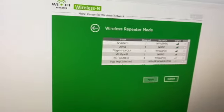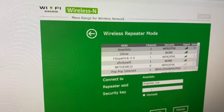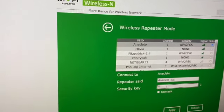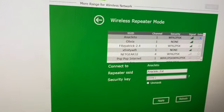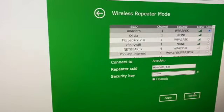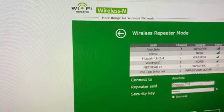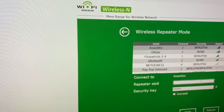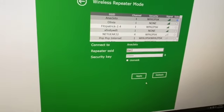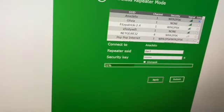We've finally connected and I'm going to select my main router from the scan results. I'll enter its password and click Apply. I also need to change the name of the repeater — I don't want them to be the same. I'm naming it 'Dan One' so I can tell which network devices are on. I set the password and click Apply. It's now changing the name of the repeater.